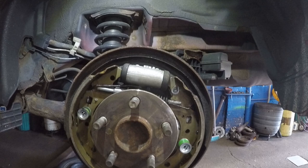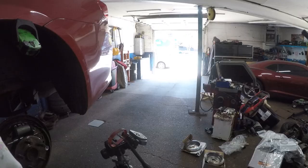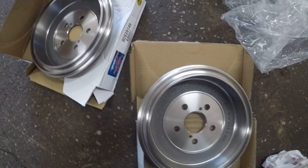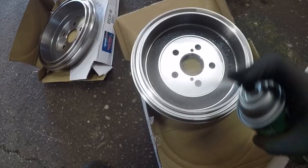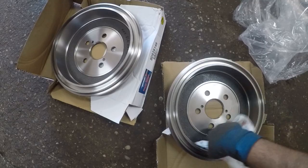Once I'm done with this, I'm going to wait for the new drums. Once I get the drums, we're going to adjust this little guy. So we got our drums here and we're going to clean them. You do need to clean the surface inside because they have oil on them — they lubricate them so they don't get rusted. So take your brake cleaner and make sure it's nice and clean, no oil, because you don't want the brakes to fail on you.